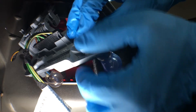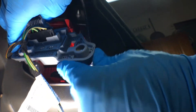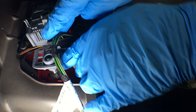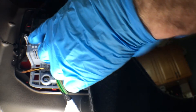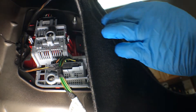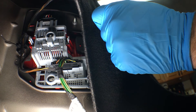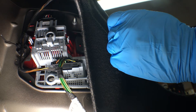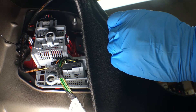That's really all there is to it. Go ahead and slide the bracket back inside, make sure you've got everything clear. The bracket lines up and you just clip it in — those two clips clip right back in. It's just that simple. You've changed the bulb and saved yourself a little money. Jump out of the trunk and we'll button everything back up and check the display.